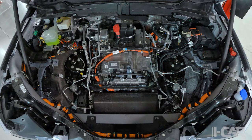I will add to consider here too, take a look, the simple part of this, if you see the side structure, the apron tubes, the front tie, what was the main radiator support, now is a totally different shape, but it is still a bolt-in part. But look at how the apron tubes look exactly like the steel vehicle. I mean, like the gasoline vehicle, excuse me. Yeah, glad you brought that up. I was kind of thinking that direction. And so basically servicing of those apron tubes is exactly the same once you get past the differences and the electrified aspects of this, that basic procedure is still the same.